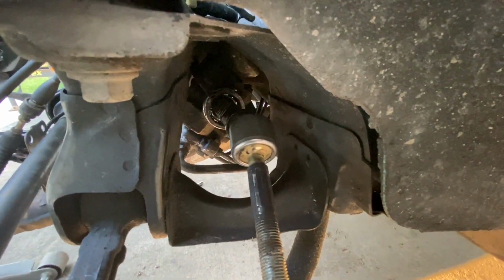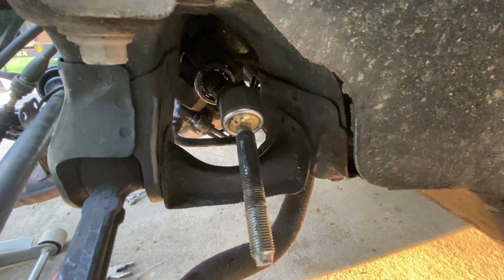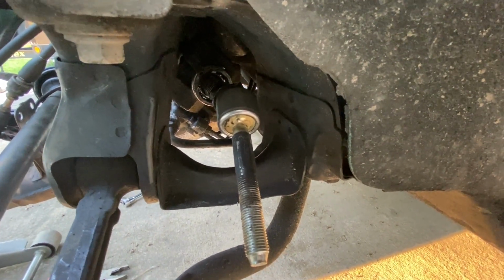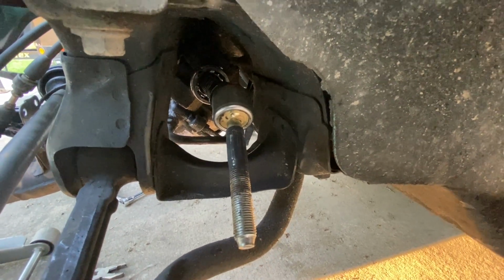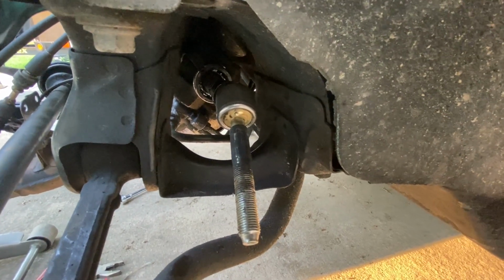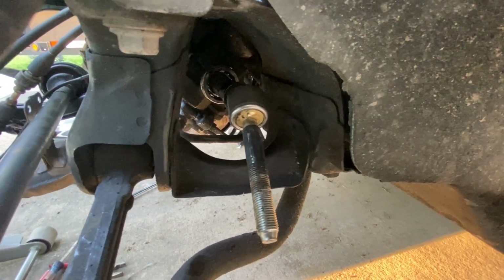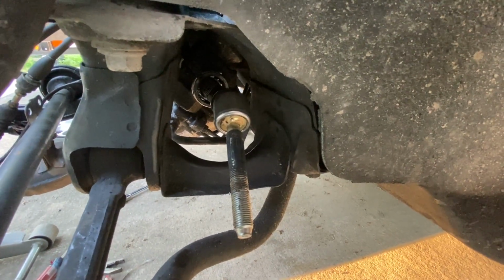And after this thing is all greased up, we can slide the new boot in position and connect the tube, and then go on the underside of the car, put that metal strap on, and then put the outside strap on, whether it's that metal ring or the tie strap that was included. That basically summarizes the installation of the rack and pinion boots here. And then we'll address the next side, which is easier.